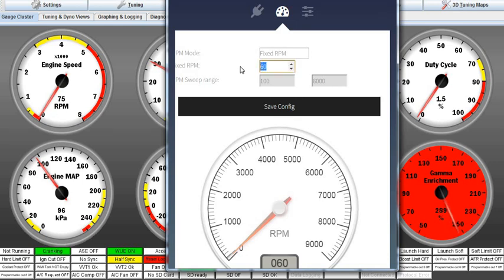And let's see what happens if I take it to 78, which is still below 100. We're at 96, it still says cranking. Or 97, it still says cranking. Let's take it up to 81. And it's at 101, now it's running, okay? And now I can probably back it down, let's try 78. Because it's not going to immediately go into cranking just because it dropped below 100. Okay, so now we're at 97. The whole purpose here is to slow my LEDs down on my board. Okay, so let's go look at those for a second before this video gets too long.